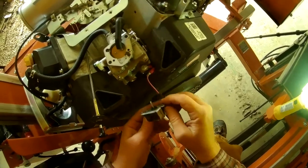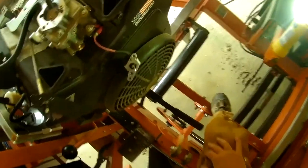I mean, this thing's not very old. I just got it earlier this year, and I had let it sit for 45 to 60 days, but still wouldn't expect the gas to be that bad or this to happen. So here I am now, not getting gas. Today, I came out here earlier and took the fuel solenoid out, was able to test it and demonstrate that it worked fine. There's a video link to that above, if you believe that it's your fuel solenoid, showing how to take it out, how to test it, how to put it back.